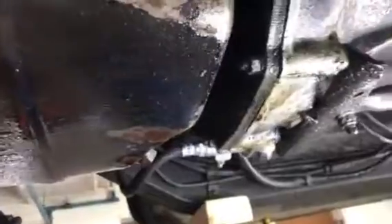Looking at this side of the engine, you can see a lot of oil leaks. The oil pan is leaking, the side covers up there on the engine are leaking, and right up here the front main seal is leaking pretty badly. That's a starting point to replace that stuff. We may also find that the rear main is leaking — it's just everything is soaked in oil right now.